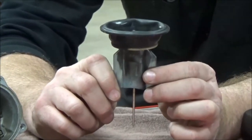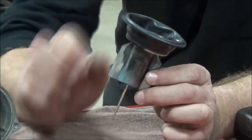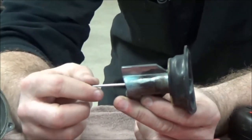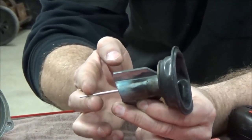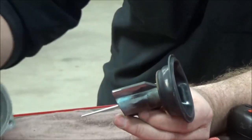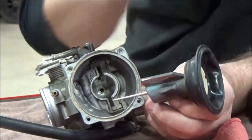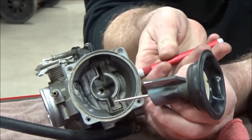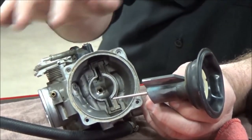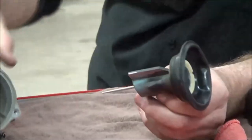On this slide, we have a needle that adjusts the one-quarter to three-quarter throttle range. This needs to be able to float — if you put it together wrong, it locks it rigid. The emulsion tube, that brass tube down inside, slides up and down through the slide. If you have heavy side load with it cocked, it wears out that brass tube and the needle — it takes a round hole and makes it egg-shaped.